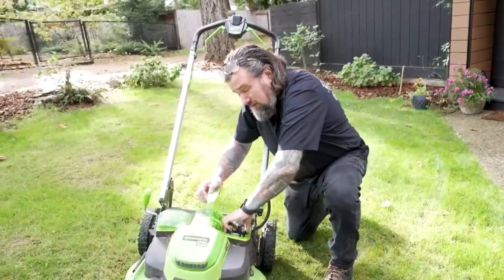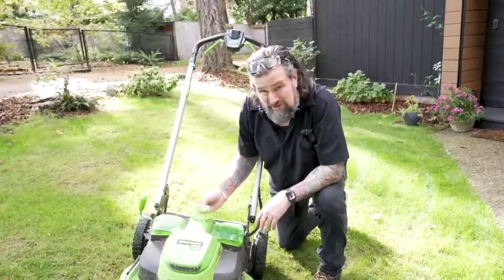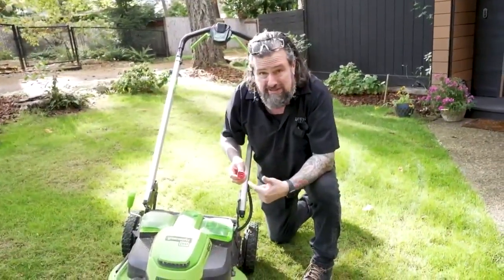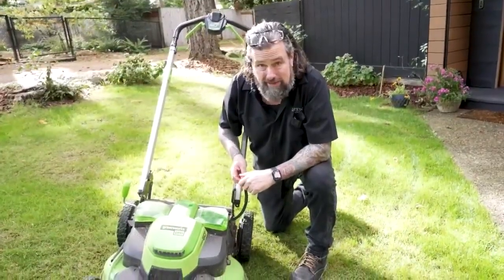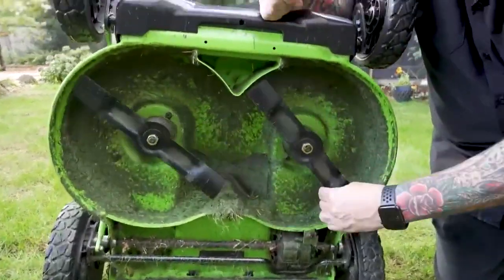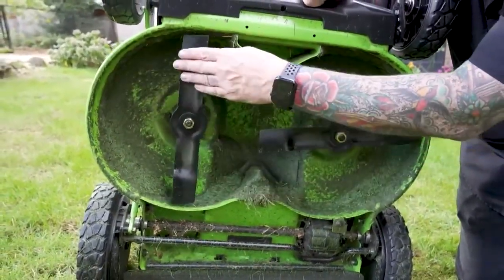The number one rule here is safety. We're going to make sure all the power is off — just like a gas lawnmower where you take off the spark plug to make sure nothing's going to start, same rules apply here. I'm going to make sure this is unplugged, including the safety. Then I'll fold this up so we can see underneath and make sure the blades are in good shape. First, inspect the blades and check their condition — you want them nice and sharp with no big chunks. If you've hit a rock, this is where you're going to find it.